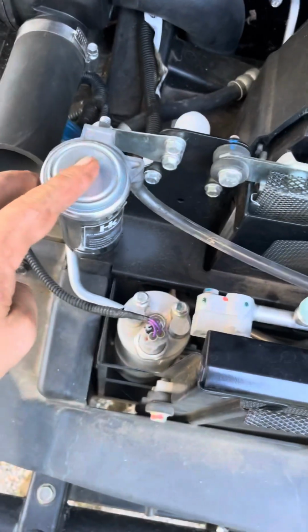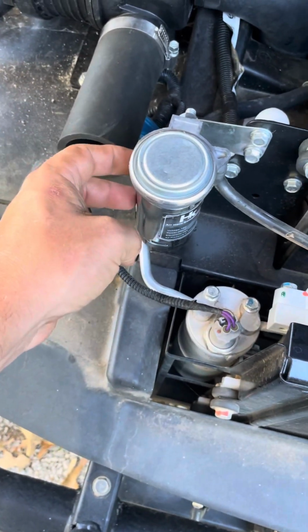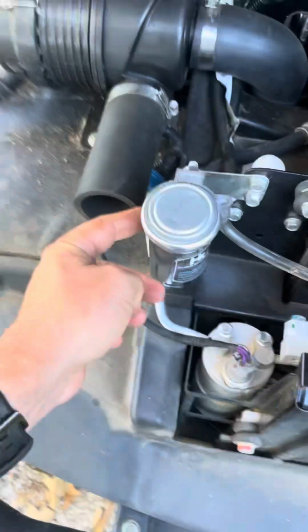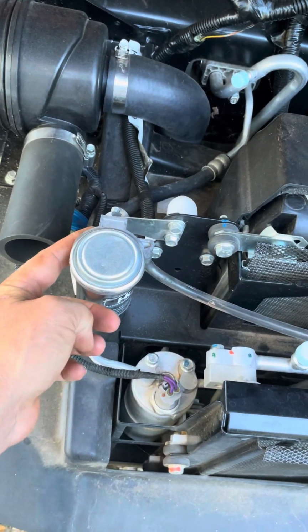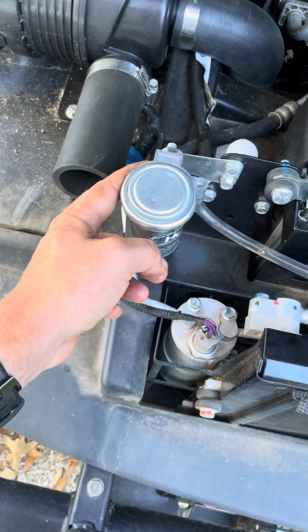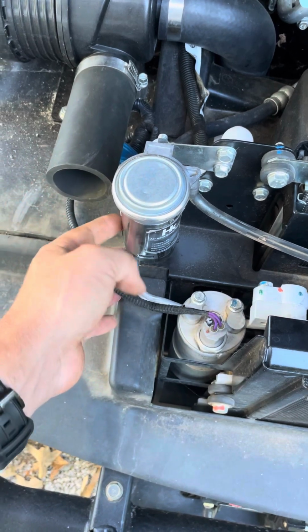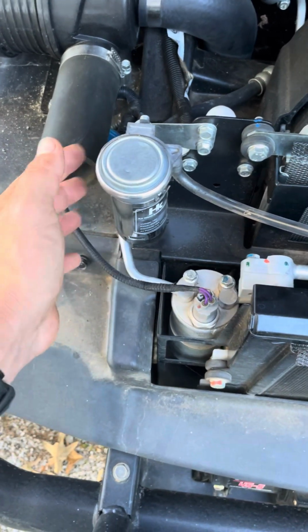That's the stock compressor that comes with your first set. You're going to buy two of these. And you keep the compressor for backup if you want a backup compressor out of the second set. You plug your compressor into the stock harness because you've upgraded the switch and the fuse. The stock horn harness itself will be fine.